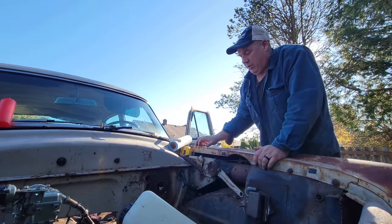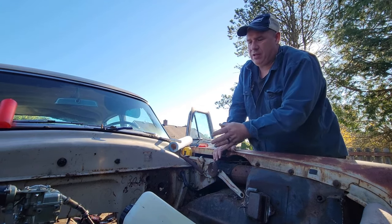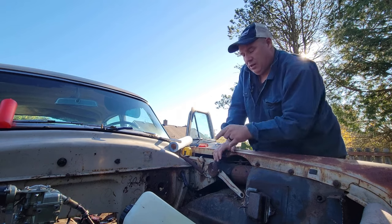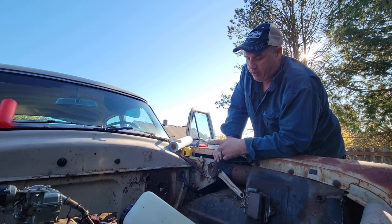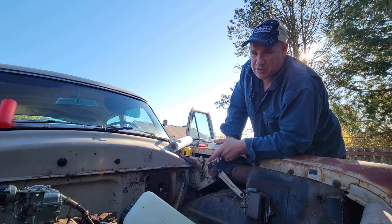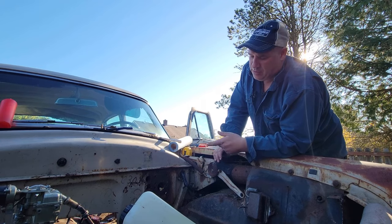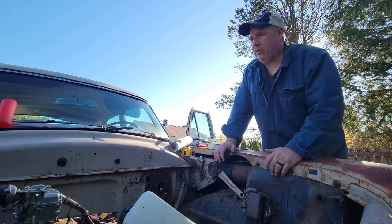Hopefully it should work. So what Mary and I are trying to do, just to keep you on pace: we got the vacuum hose connected. I'm trying to depress this rod to see how far, because I have 1 inch of throw on the pedal, and if that's less than an inch, I'm in good shape. If it's more than an inch, then I've got to either reposition that, figure that out, I don't know, or not have full brake pedal. Those are all options.